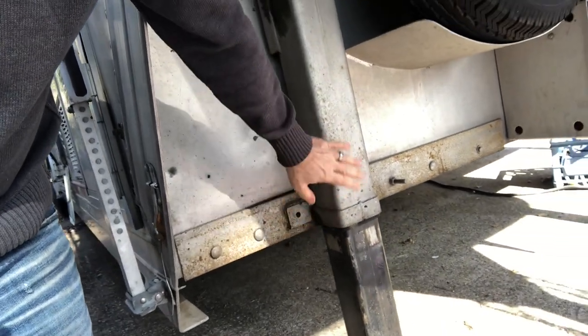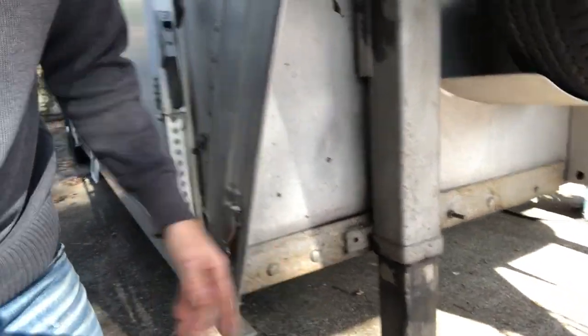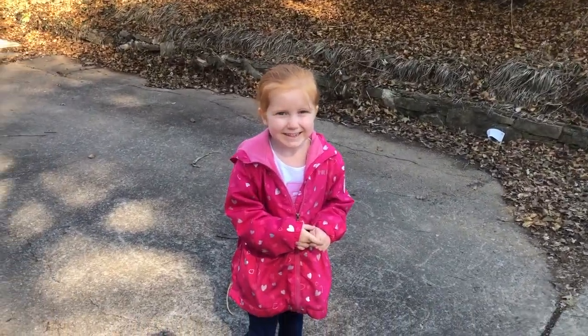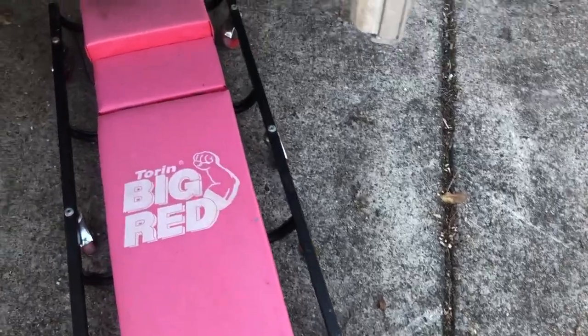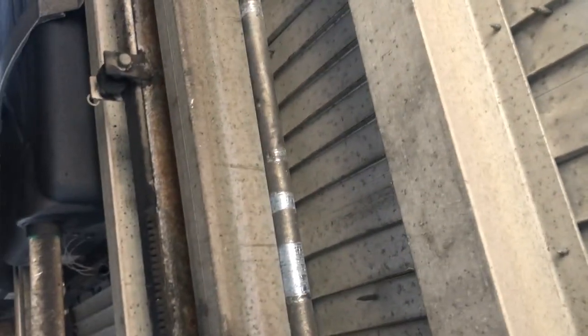You can see here this piece was put back in on a repair. At some point, somebody pulled forward with this jack down and it folded up underneath the trailer, damaging the entry and kind of bowing the floor up. Me and Lily are out here working on the horse trailer together. I took the motor out for the slide-out and that motor is toast. The slide-out has got some issues. Welcome under the horse trailer — the shiny parts are where I've been using vice grips to turn the actuator. That's the bar that goes all the way across to the other side where you can put the hand crank on it.